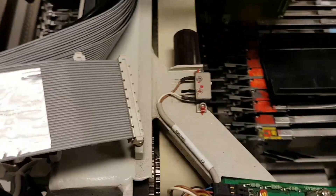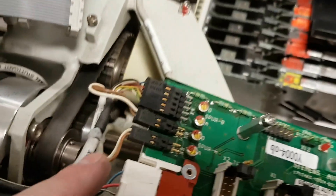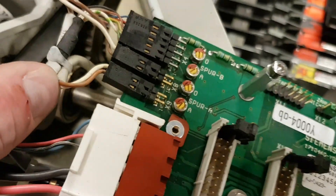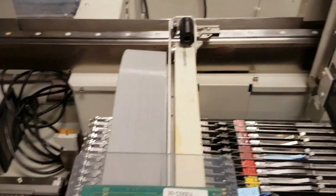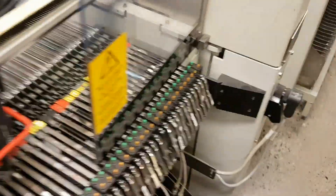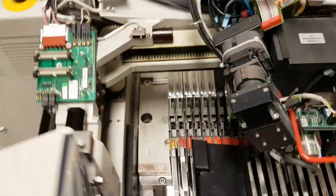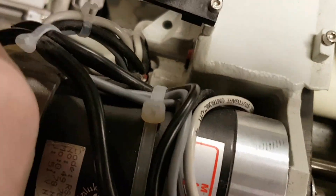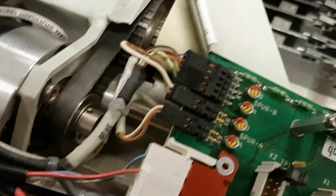If we look around the head — no, they don't appear to come up. So those wires are definitely coming back to this cable here, and that's the beige cable. The beige cable goes into those two. That's the limit switch — those two are coming to there. So that other beige wire is running to the limit switch at that end of the gantry. The beige wire here goes to that limit switch, which then runs through the gantry, coming out through there — that's the wire which wraps around and comes up to these being your limits, that being the magnetic encoder, the main cable going down to it.